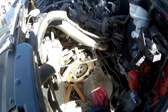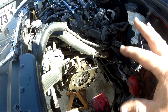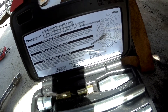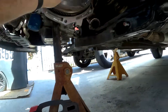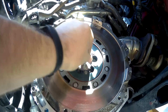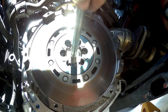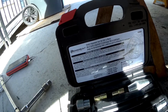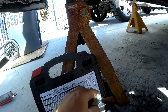Next, the plan is to put the new clutch disc in and get everything torqued down — the manual shows 15.9 foot-pounds. This kit comes with a center shaft and bushing adapters for the pilot hole. You just have to find the right one that fits the snuggest — this one happens to be mine. These two pieces screw together and it stays in there pretty solid. The next part is to figure out which end of the shaft to use — most likely the tapered side.